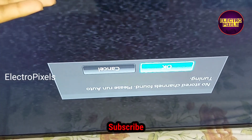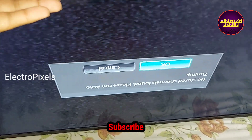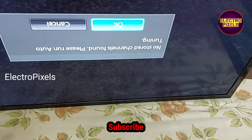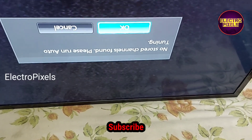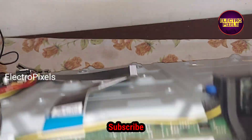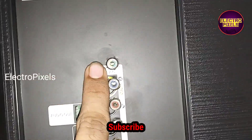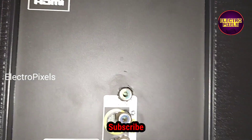You can see the final result — the TV is working properly. Instead of using an LCD/LED universal U11 board, we installed the alternate Samsung motherboard. But to fix the back cover of the TV we need to do a small modification — we cut down some portions of the back cover to fit this motherboard.